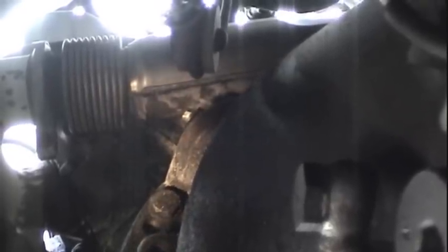And you basically just want to go in with a twisting motion and work it on down into the bore. There's a cylindrical bore in the bell housing right there that's pretty tight tolerances, so you'll know when you have it aligned properly and can go on down with it. So, there's one, then you can just go ahead and use your Allen wrench right there to tighten the bolt, and you just want to go snug with it. It's just going into an aluminum bell housing. There's no point in zonking down on it real tight.